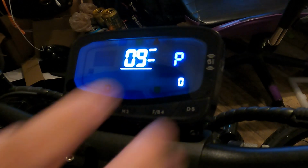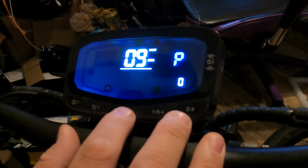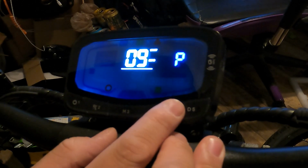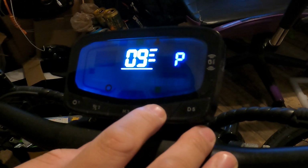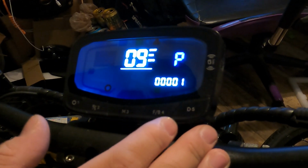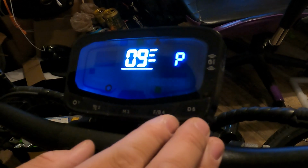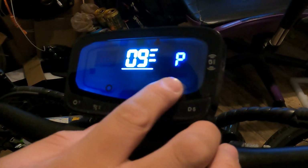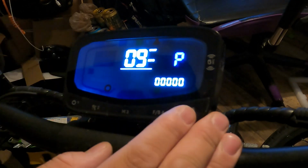All right, so P9 is actually the boot settings. So basically, right now it's at 0, which means that once you engage the throttle, it'll just take off. But if you wanted it to be a weird feature, like a rolling start, if you set it to 1, you would have to initially push off with the scooter in order to get the MOLO-5 to start.